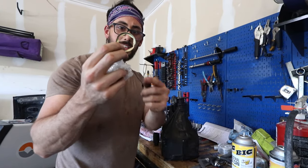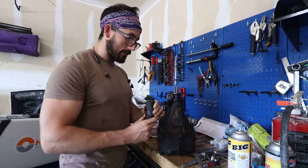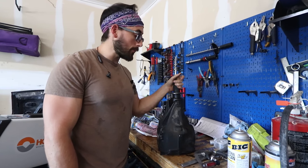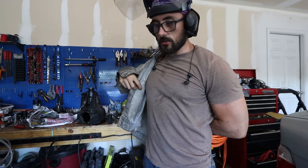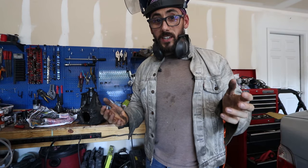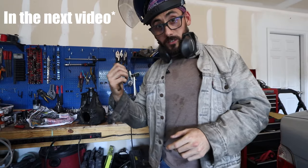The first thing I did is I took this little piece out. I had to hit it with a screwdriver because it's kind of in the wrong spot - pain in the ass to get out. Then I have to get a 30mm impact socket. Problem is it doesn't fit, so I'm going to have to grind this socket back to where it'll fit properly. Also, there's been a lot of work I've been doing on this car that I haven't been filming, mainly because I'm trying to get shit done - filming makes it like 10 times longer. So I apologize if I don't show every little detail, but I'll go over it later in the video.